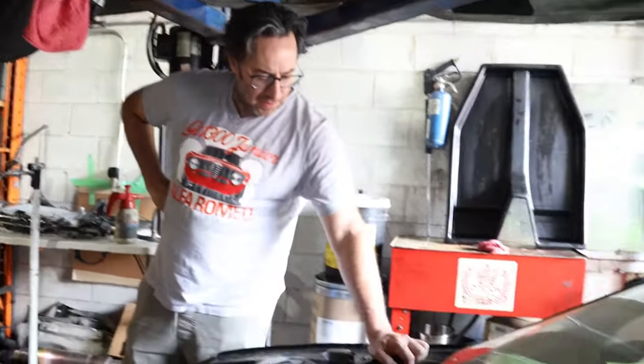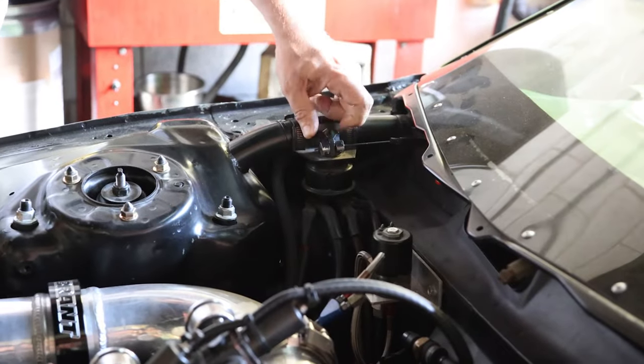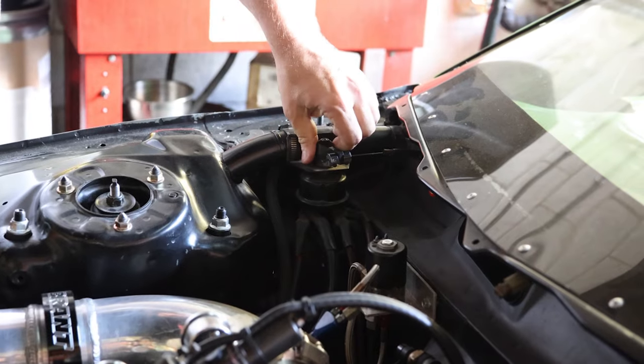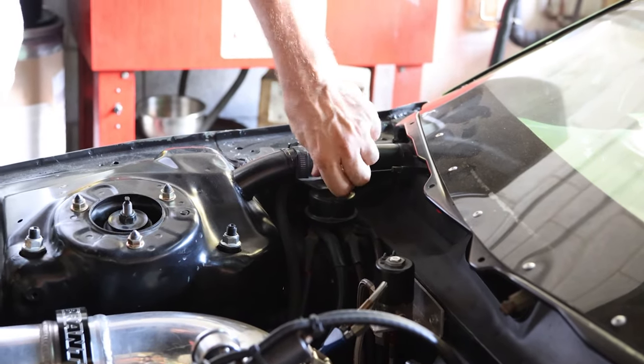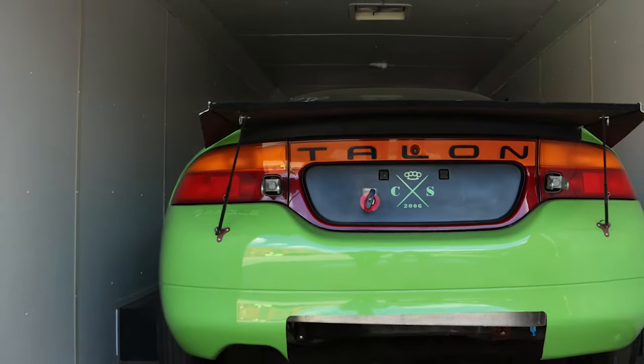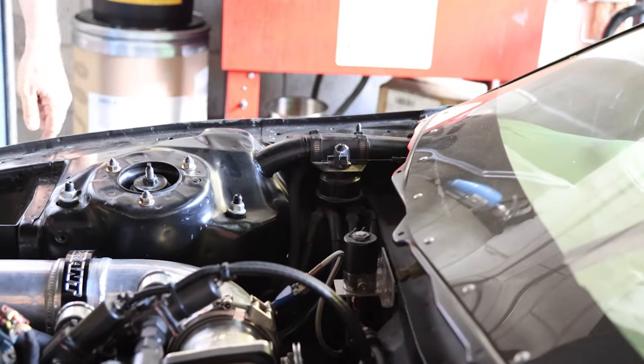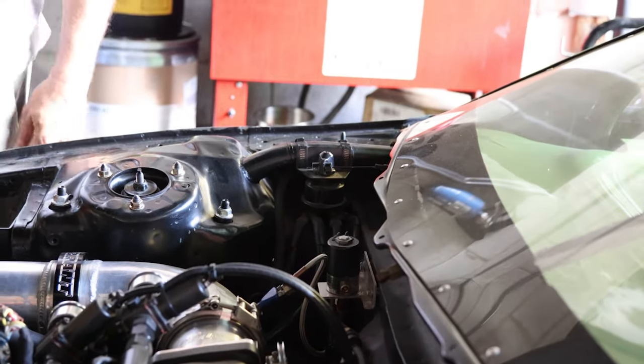Notice here on this car, I was always trying to make everything super light back in the day, so I put the shutoff switch here for the car. We had a cable in the car that runs all the way to the back, because the cable can be thin and super light, and then all the battery cables were over there. So that's still there from when I built that thing 20 plus years ago.